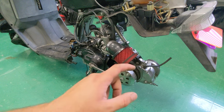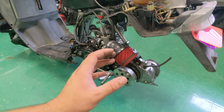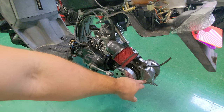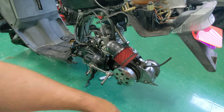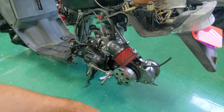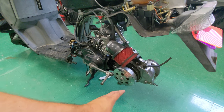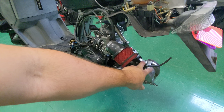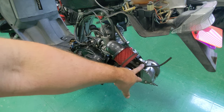And before you do this, make sure you can take out the fill plug. That's this little guy right here. You would hate to drain this thing out and not be able to fill it back up. So definitely important to get that taken off first. Also, don't do this without having the correct gasket. You can order these through Scooter Swap Shop through their S23 line.